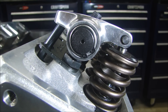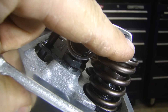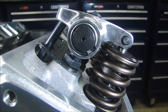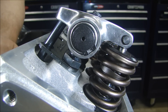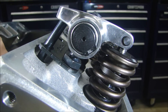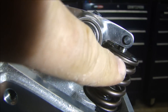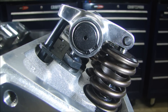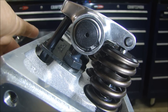If I just reach under here and lift this up, you can see how as I lift it, the angle in here is going to change and the roller is going to move towards the center of the valve. So I'm going to adjust this pushrod by unscrewing it until two things: one, I want the roller in the center of the valve. Got to keep going until you get that in the middle — just about in the center of the valve right now.